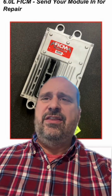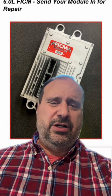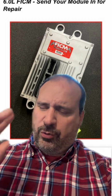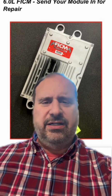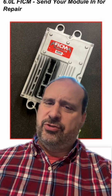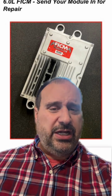Holy buckets. Then the truck starts, you think you're in high cotton, but no, the glow plugs are going to stay running for as long as 2 minutes after ignition. So at 0 degrees, it's 2 minutes. At 30 degrees, it's 1 minute and 15. At 45 degrees, it's 45 seconds. At 50 degrees, you can do the math, a little linear line going on there as far as how long this is going on. But you've got a pulsating 230 amp draw, and your stock alternator is only 110 amp, and that's even a marketing number because it only does 75 amps at cold idle.